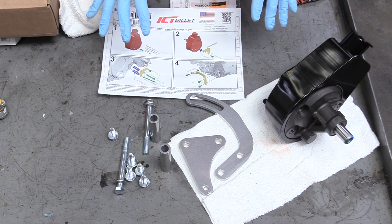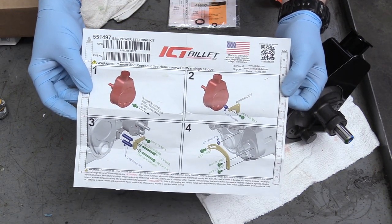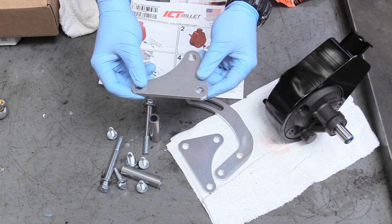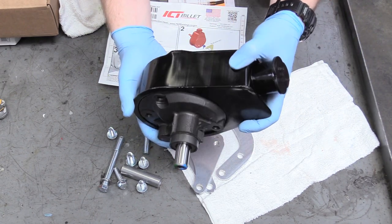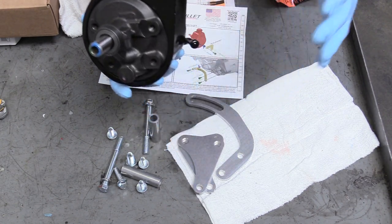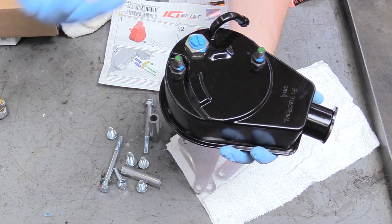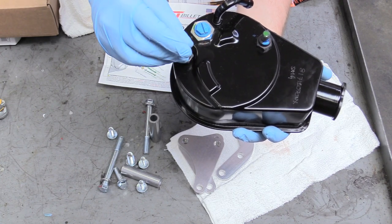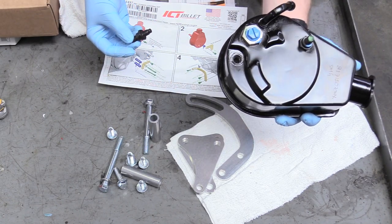So now we can move on to our power steering pump for our front accessories. The first thing I'm going to go over is this really cool kit we got from ICT Billet, linked down below in the description. The machine work on this aluminum is really, really nice — this is a high quality bracket system. The other thing I want to go over is our power steering pump — this is a new unit from New Advanced, link down below. The only thing you want to look for when it comes to this kit is that the kit is reliant on this stud existing. If this stud doesn't exist, go ahead and get a different power steering pump because you need to be able to remove it. I've already broken this loose on the bench with an 18 millimeter wrench, so I can remove it on camera, because we have to remove this and replace it with one of our brackets, a spacer, and a bolt.